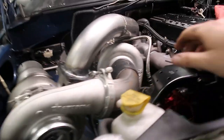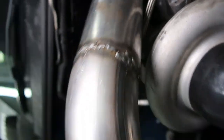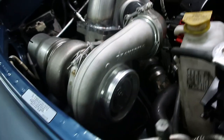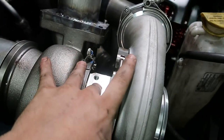I'm going to have to clock this oil line a little more this way so it doesn't touch the pipe — it's close but there's some room. I just need to do a weld right here, then get this bead rolled on the edge. We have plenty of room for our drain down here. Keep in mind this engine is going to torque and move, and everything on this turbo is going to move with it — so we don't want it banging against the fender well. I can stick my hand all the way under the exhaust housing and under the flange, so there's good clearance.